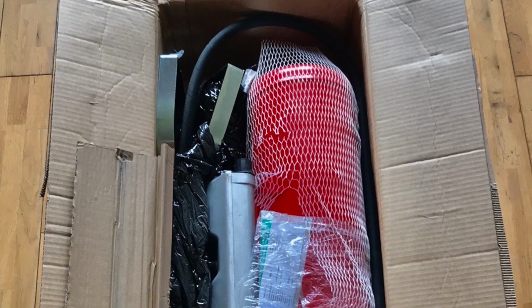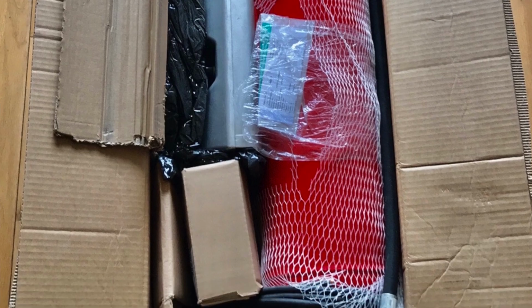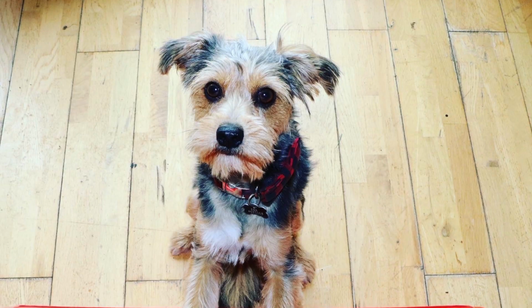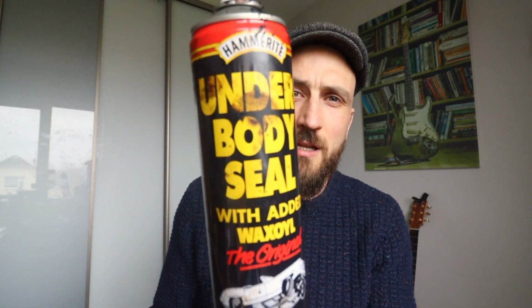On this episode of the van build, I'm going to be showing you how I installed the LPG tank under the van. Unfortunately, I mistakenly deleted the spraying of the tank for this video, but all you missed out on was me spraying the tank with some underseal. What I sprayed the tank with was this underseal, and you can buy it in Halfords. It's got a wax oil. It protects the tank from stone chips, corrosion, water, and salts that are on the road when you're driving along.